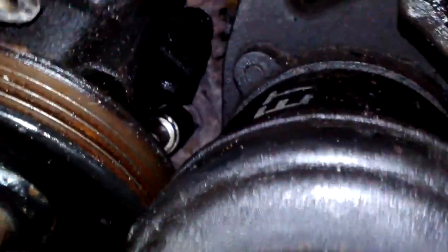The second one is to the right side of the crankshaft. And then there's one that sits back up in there that connects to your power steering pump — your power steering pump will just fall, so be careful when you do that. I never found out about that one until I was messing with the thing and found it just spinning. I ran my hands along beside it and found there was a bolt there holding it on.